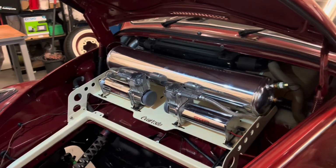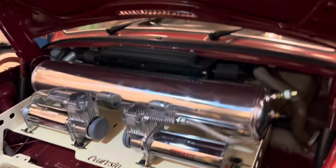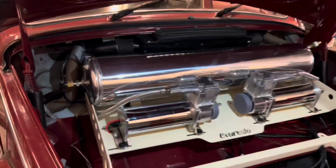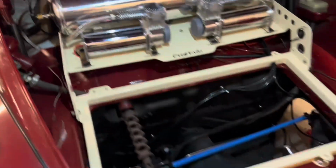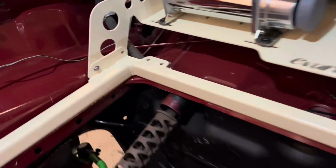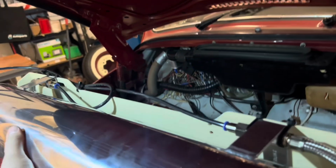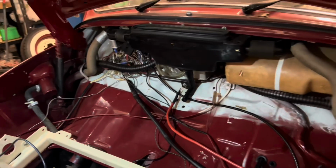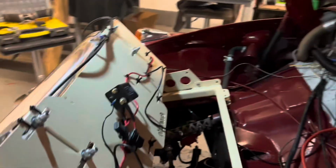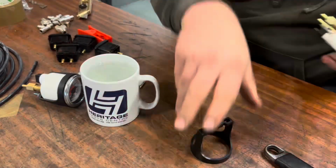So we've got this dropped in place, and you might notice a couple of things. It's hard to get to the wiring to connect it all up, and it's also hard to get to the wiring inside the car itself, should you ever need to check on any of the relays or connections up there. So before bolting it in fully, you can just leave these front bolts in there, one per side, and the whole unit can sort of hinge forwards like that and let that rest like so. And get to all your wiring stuff, and of course get to the underside of this, which aids greatly in actually getting it all connected back up again.